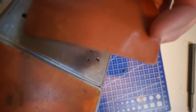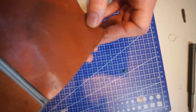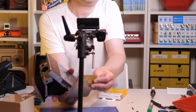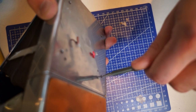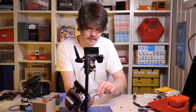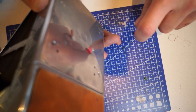The first thing you need to do is remove the leather base — the leather skin underneath. This can be quite stuck because it's very well glued, so it was a bit hard to rip off. Make sure you get the aluminium part that is kind of part of it. I used alcohol to remove any remaining glue. Now I'll use the Torx 4 again to open the base compartment. Under here there is a connector for the battery that is quite simple to get access to.